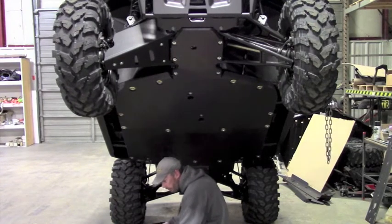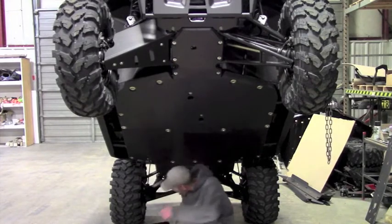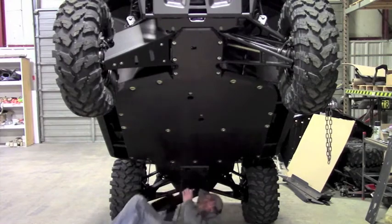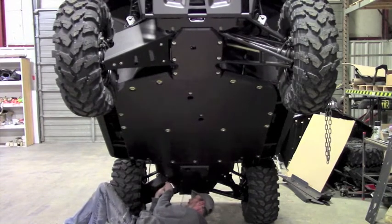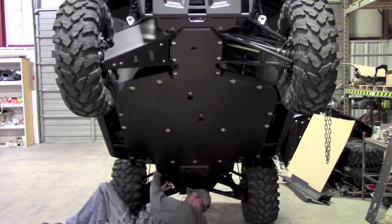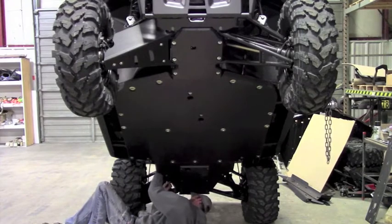The rear has a bar clamp with two short bolts and two long bolts with washers and nuts. I'm going to fit the two long bolts first. There are already holes in your A-arm from the factory. Just set the skid plate into place, line it up with the hole, run the bolt all the way through, slide the washer over the bolt, followed by the nut.